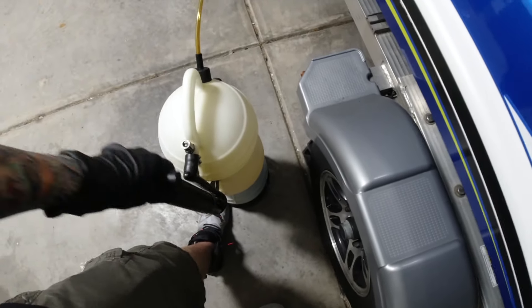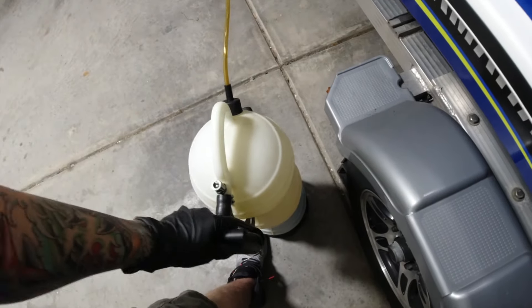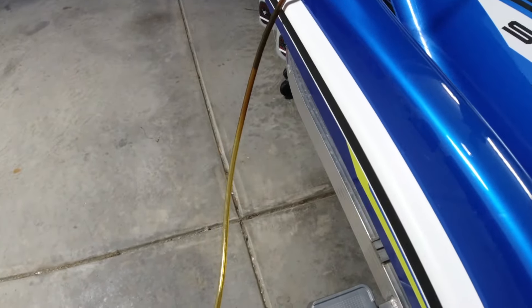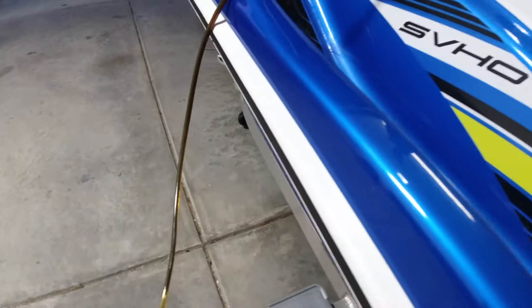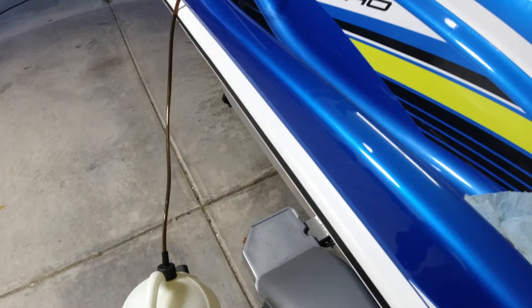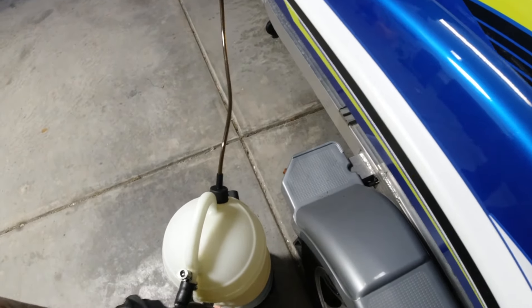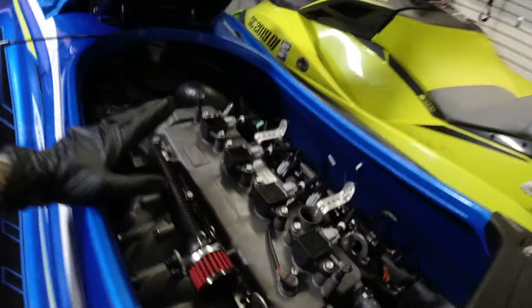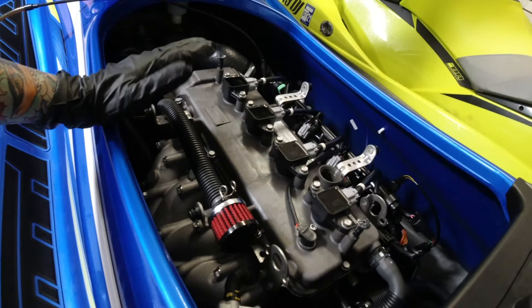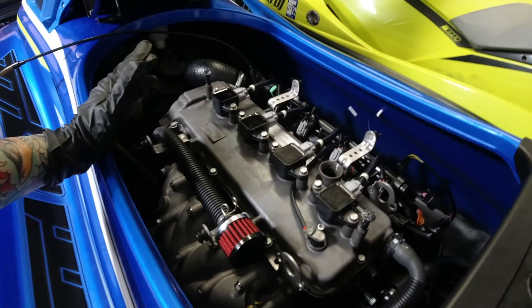You don't really need the giant extractor since it's only two personal watercraft. There it comes right there — get it going. You don't have to continuously sit here and pump; you want to get it going where it starts draining out. When it ends, it'll sound kind of like when you're drinking something out of a cup with a straw — you're going to hear that sound when things are empty.